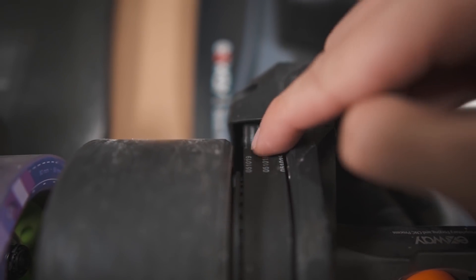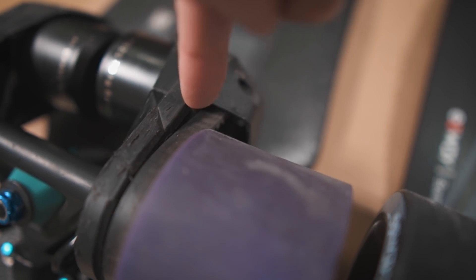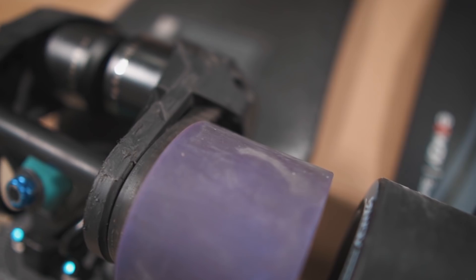So again, this is too tight. It doesn't look too tight to the untrained eye, but this is too tight. This is about right. There is an exception though: if your board is using 3M belts, then this is probably too loose. But most boards that have come out recently use 5M belts as far as I know.